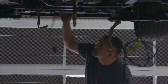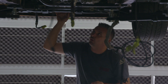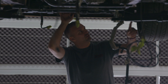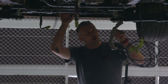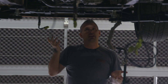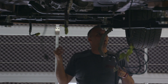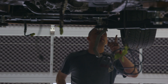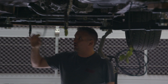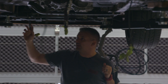Starting up the front, the front subframe doesn't appear to have any damage, which is good, so it's mostly going to be a clean up. A couple of little tabs have been welded on, probably to hold aero and front diffusers in place. It has R34 GTR alloy front lower control arms — probably did that for weight savings — but there's no adjustment, so catch 22, I don't really want to use them. Looks like it's still got a stock sway bar, surprisingly, so that'll be getting ditched. The uprights need to be completely pulled apart and refurbished. I'll have to put new hubs in because it hasn't had any drive shafts in it for a long time and these tend to collapse the hubs when that happens. It's getting all new suspension arms, so that's pretty easy.